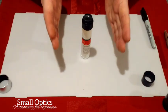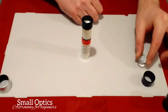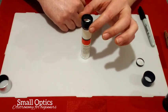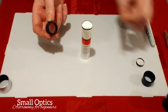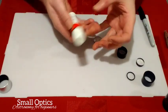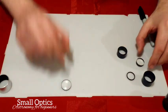Now, the lens components. First you have a double lens — set that somewhere safe. You may or may not have an additional spacer; if not you'll just have one spacer. Then finally you're left with a single lens. Using this extraction method keeps your fingers off the lens and keeps everything organized when removing the lens system.